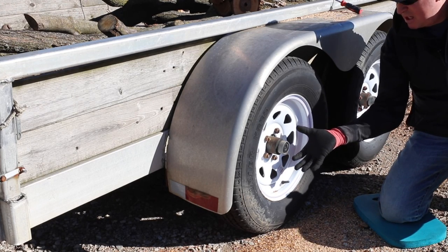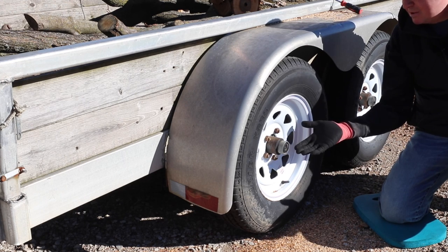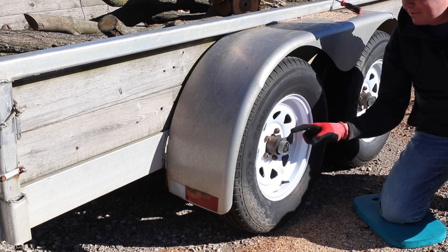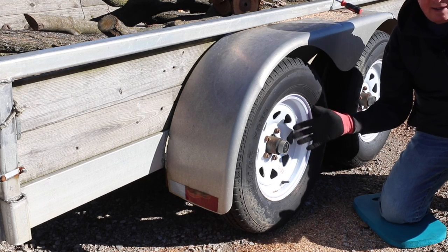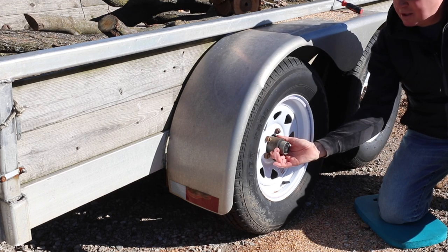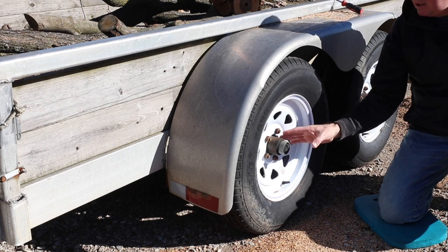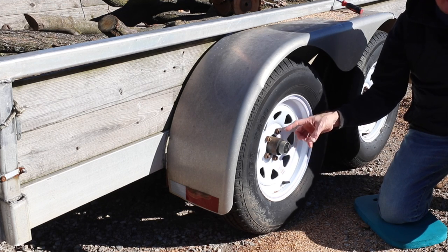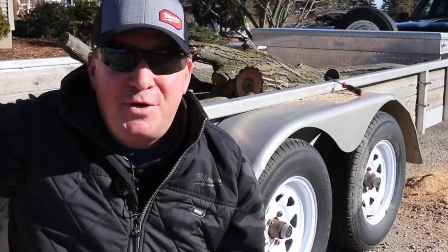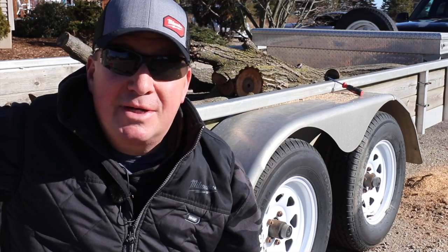If you don't have this type of setup and you're looking for an easy lube system, there are bearing buddies. I used those before on a fifth wheel camper — we used to haul it three hours one way up north every summer a couple of times, and I put those on and it really worked out well. Another thing after taking your trailer for a spin is to feel the hubs and see if they're getting warm. If they're starting to get warm or hot, you may want to bring them in to somebody to look at them, maybe replace them, or find a video online on how to do it yourself. If you're interested in me making an in-depth video on trailer wheel bearings, let me know down below in the comments.